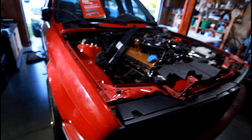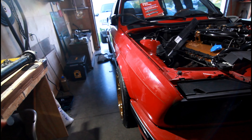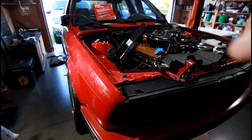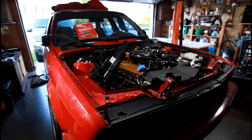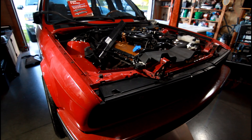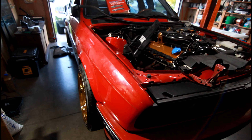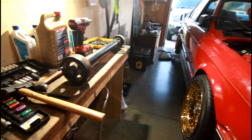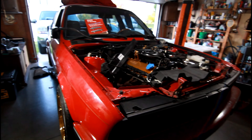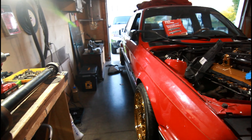So I just wanted to throw that in here. Other than that, the only things left to do are the driveshaft heat shields, throw the exhaust on so I can start it up, and we also have to bleed the clutch. I gotta put that spring on the clutch pedal. All the fluid's already in the car and nothing's leaking — obviously, until the pressure comes on when the car starts, and then we'll see if we actually have any leaks. That's basically just the last few things to do and then we can start her up.